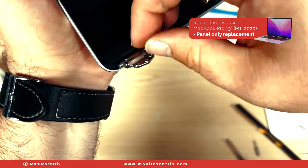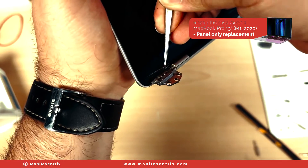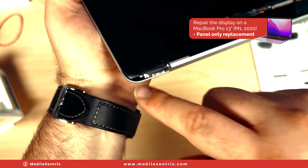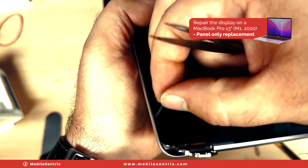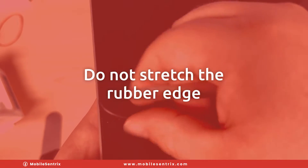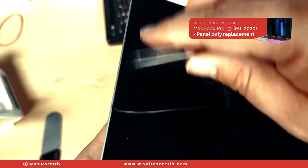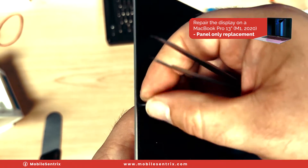For this next part, I'm just going to get my fingernail under here and gently lift up the rubber — just grab it gently and get it to release from its adhesive. You'll see there's a black adhesive down below. You can gently peel it up at the same time, or just go nice and slowly and let it come out. If you go slowly, you won't stretch or tear this rubber, and we can reuse it if we're gentle.